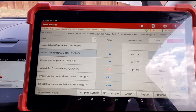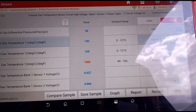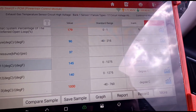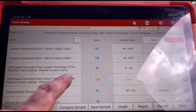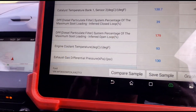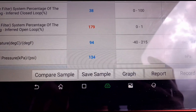That sensor is all tightened down. Exhaust gas temperature sensor — this engine doesn't have a sensor three, so we've got sensors one and two and you can see they're now working. We ran the vehicle for a few minutes to get temperatures up — we've got 140 degrees on exhaust and 90 degrees on coolant temperature. Now we're going to get the DPF sorted out — get the pressure and soot accumulation down. We're going to do a DPF flush rather than a forced regen. Holding revs around 3000 rpm we want to get the pressure down to around 40 to 60 millibars.